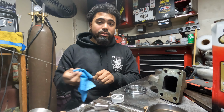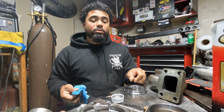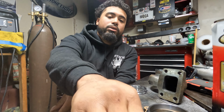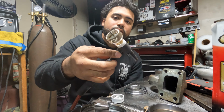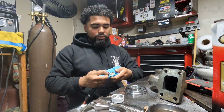It's gonna protect your cup on your TIG torch. If you're welding dirty material and all that stuff, you're gonna get splatter and a whole bunch of stuff that's happening inside of the weld. And what that's gonna do is it's gonna back up your gas lens on your nice Furick BBW cups. It's gonna get all that dirty, and then you have to replace the lenses and all that stuff when you didn't have to, if you would have taken care of the stuff.